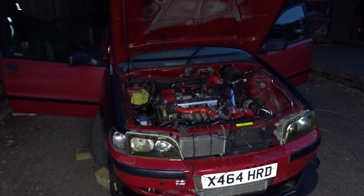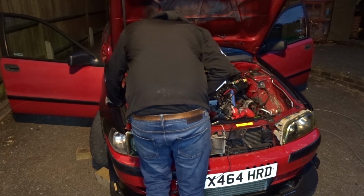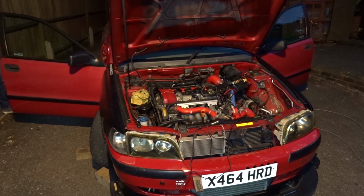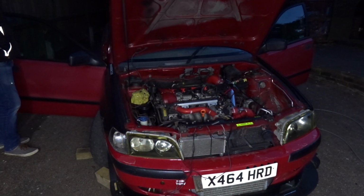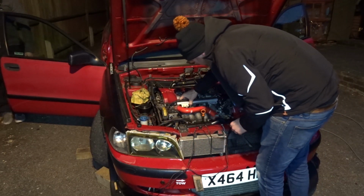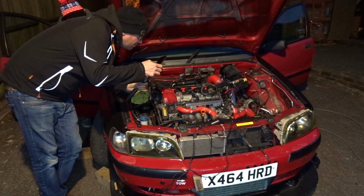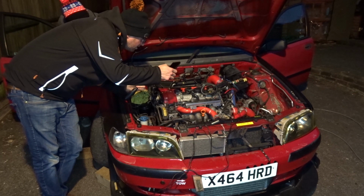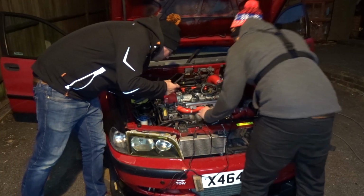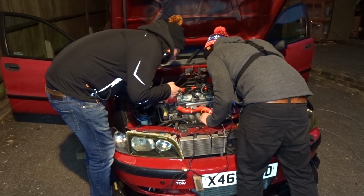I reckon plug the injectors back in. You unplugged all 4. Right, they're all back in. You've got fuel now. Do you want to undo the rail? Just confirm that the injectors are squirting in order in the right way? How easy is it to lose the little spaces? Go for it. 1 and 3 have fired very, very little there though, mate. But really little compared to that priming round. Mind you, that was 50% duty, wasn't it?